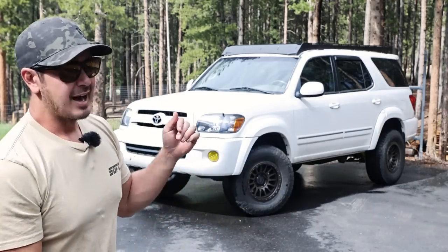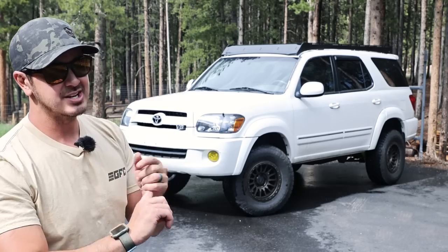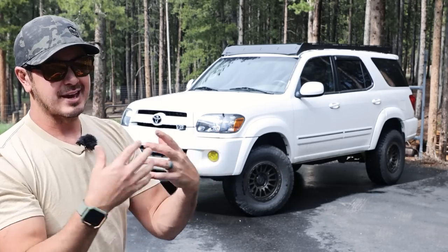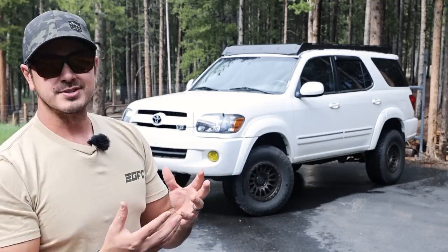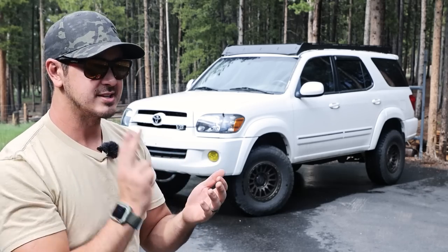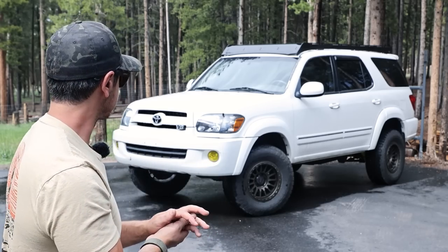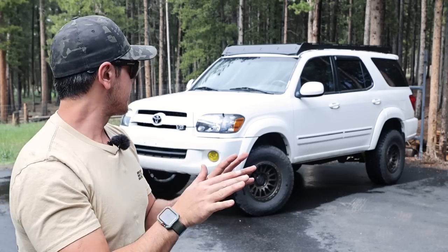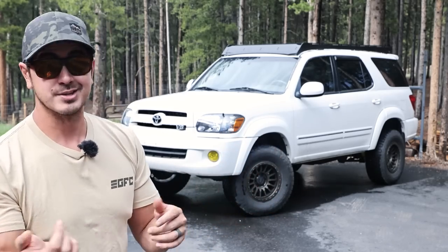It was pretty straightforward. I did however take it to a shop to get the timing belt changed. I had some camshaft leaks and they just did everything — timing belt, water pump, a couple other seals replaced. They also did the UBJs and the LBJs, so the lower ball joints and the upper ball joints. So this truck is now pretty dialed and good for another 100,000 plus miles without anything but oil changes, hopefully.